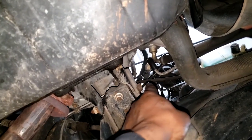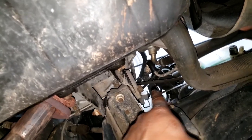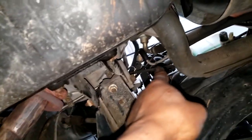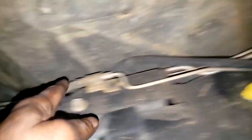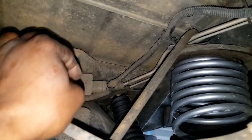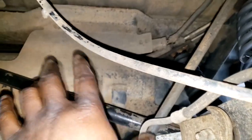Alright guys, so y'all remember that black hose up top — that's going to the back. During my process of elimination I found the source of my leak was from the rear. That line coming from the canister goes through this metal tubing, it's still rubber right here but eventually it turns into metal tubing going all the way to the tank. You don't visibly see any smoke through this line. I can take the line off right here and clamp it off and my ball should drop. So the leak is in the tank or fuel filler neck area. It's still pumped up with smoke, so what you do is look around.